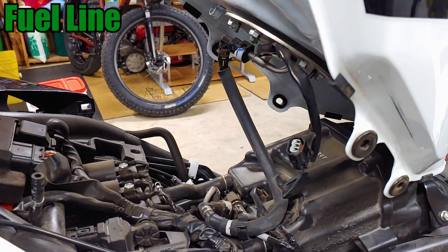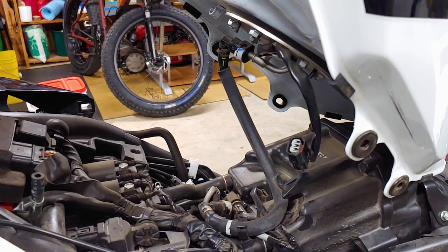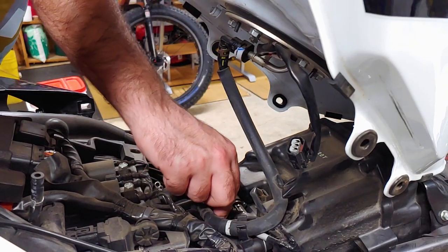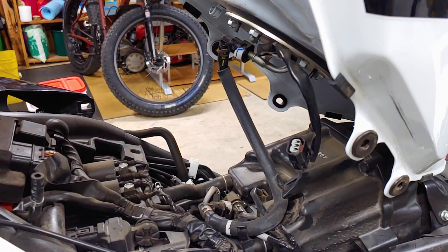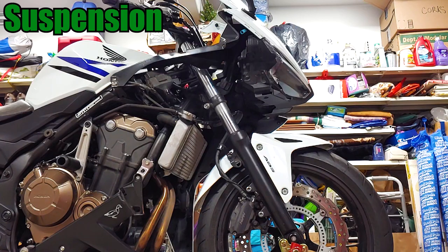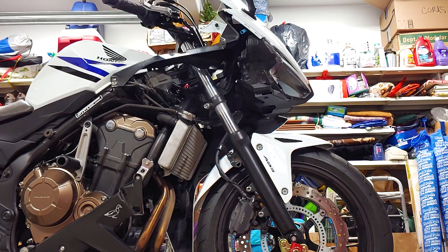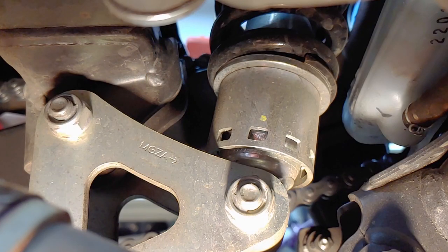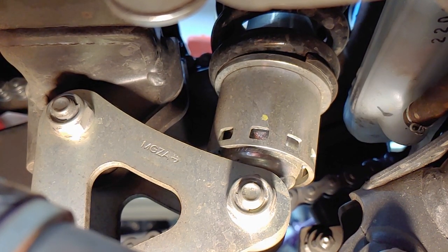With the fuel tank in the fully supported position, we can inspect the fuel line for damage, deterioration, and leaks. The hose fittings should also be checked for looseness and damage — replace the fuel line if needed; it's called the fuel feed hose. The front and rear suspension should be looked over carefully for oily leaks, damage, and loose fasteners. Replace anything that can't be repaired and tighten all fasteners holding the suspension to the bike. If oil is leaking out, it's time for a fork service or a rear shock service, which includes replacing the oil and seals.